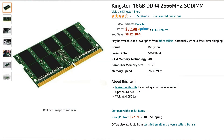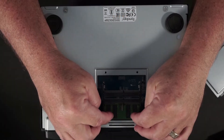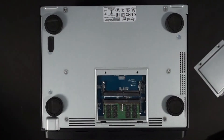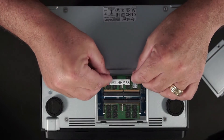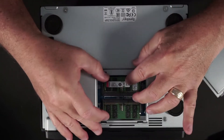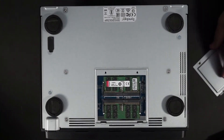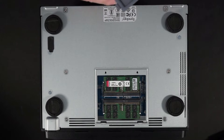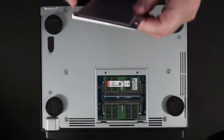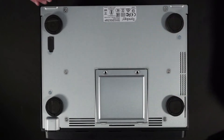I know I'm not using the Synology memory and that's okay — I bought this memory with my own money so I'm going to go ahead and use it. Let's get the second memory chip lined up in place and seated. Now we'll put back the access panel.